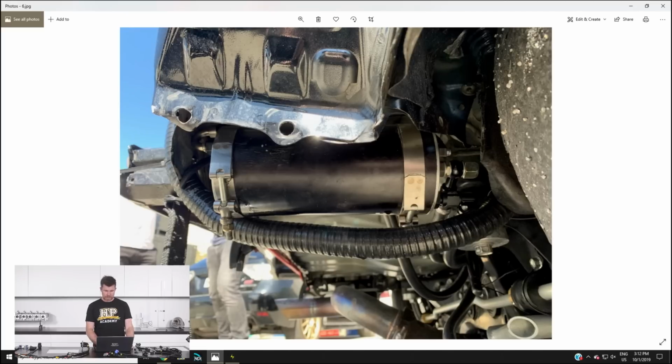And I'll just show, there's a side shot of that surge tank system. What we ended up finding was, during Ben's stint, he got in about halfway through our 1 hour race, and just towards the end of my 1 hour race, I was starting to get driver warnings for a low fuel pressure and the car was starting to surge. I thought that was just because the fuel level was low. We only had about 11 litres left in the tank. Came in, did our pit stop, put another 40 litres in to top it off, and Ben headed out. And on his outlap he was already complaining about fuel surge. So that didn't really make a lot of sense.